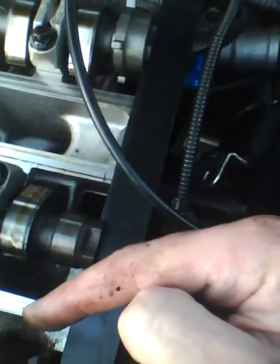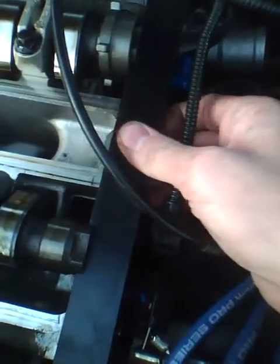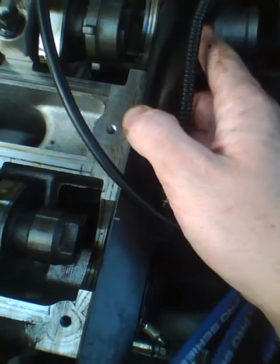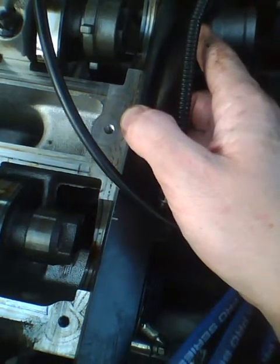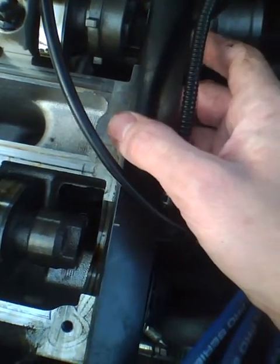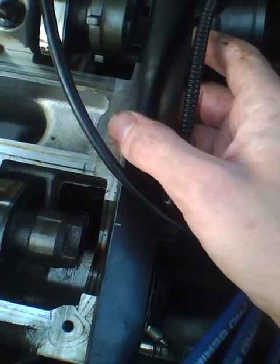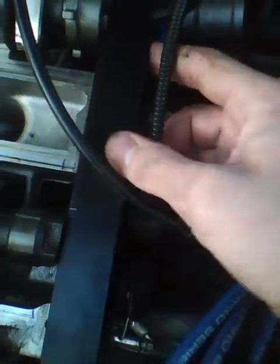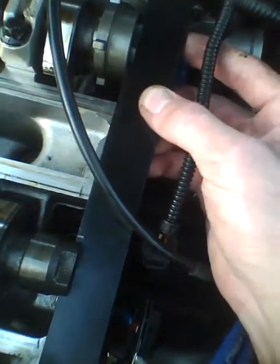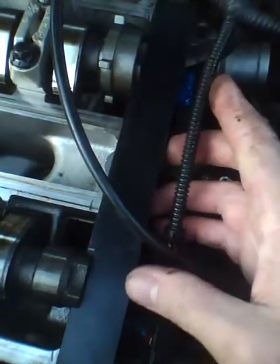But I don't know if the crank hit up against the pin. So let's take the bar out. Now, can you turn any more to get against the pin? Nope. No? See, that's weird. So now we are up against the pin, and now they both line up, only if we go really slow and I make sure to put the plate into the intake cam first.